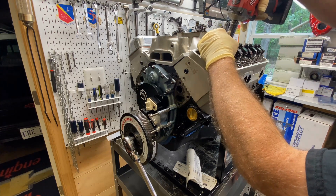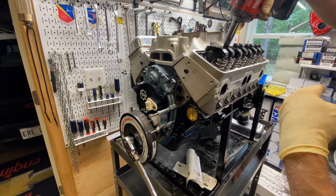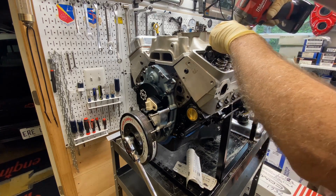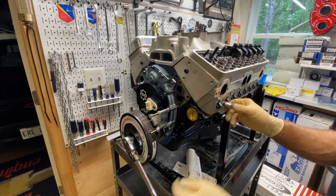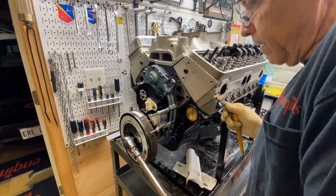I don't have to be on compression stroke or exhaust stroke — I just need to have the valves out of the way so they aren't hitting my stop. Finding top dead center doesn't matter whether it's compression or exhaust, because I only care about compression stroke if I'm going to set a distributor in there. What I've been using is a socket extension — I find it to be the most consistent. I'm going to go in until it stops, with the A pointing straight up, and hold it consistently.